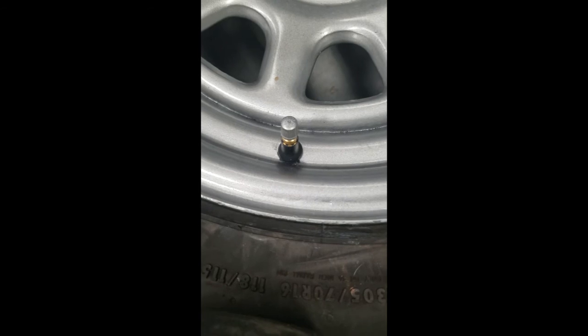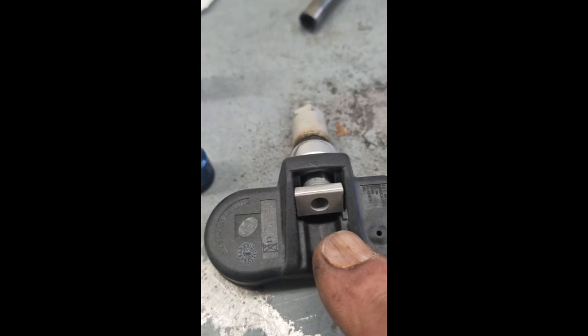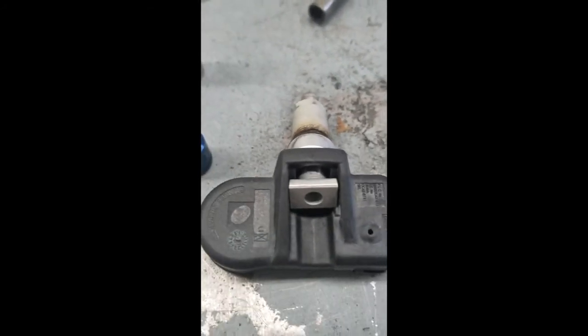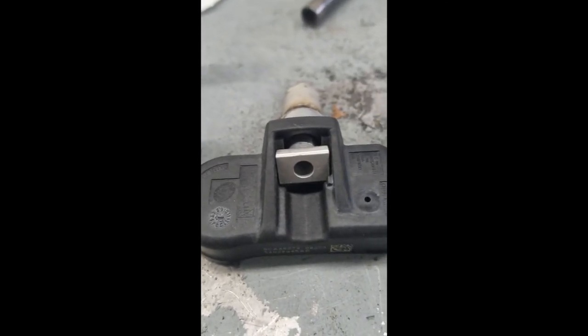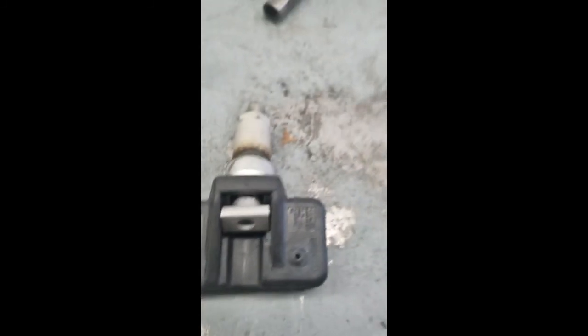It's found the sensor and it's ready to go. This is a good foolproof way to get rid of the corrosion, the leaks — periodically if you live in a climate where it snows and there's salt on the roads, even these plastic valve caps will seize on aluminum stems and the end snaps off, leaving you with a flat right where you are. Thanks for watching. One last thing I forgot to mention: after you drill the holes larger, the screw that used to hold the sensor to the valve stem will now pass right through the hole. The screw didn't have much of a head on it, so I had to get some very small flat washers — just one per sensor — put it on the screw head to keep it from passing clean through. Otherwise the sensor will fall off the wheel.